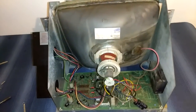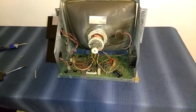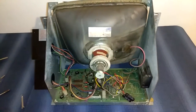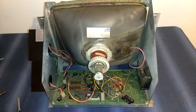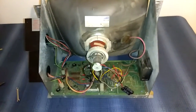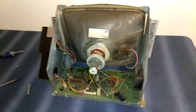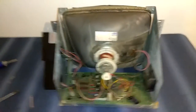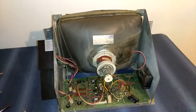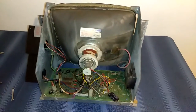First thing you should check out is the power supply. Luckily I had another proven working power supply, so I swapped it out and still no results. When you first power on the machine, there's a little LED on the game board — unless you have a very early revision — and it should turn on for a second and turn off. If your LED stays on, that means you have a problem with your game board. In my case, the LED turned on for a short period of time and shut off.